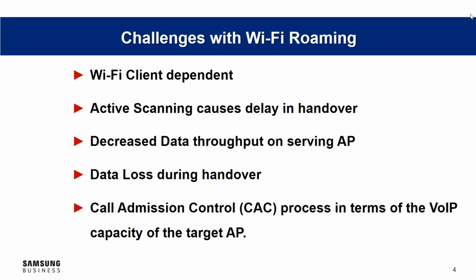and you don't have any control over changing those thresholds. Those include things like the scanning trigger as to when to trigger the scan, and I'll talk a little bit more detail about it. Roaming delta and roaming triggers and all those things.